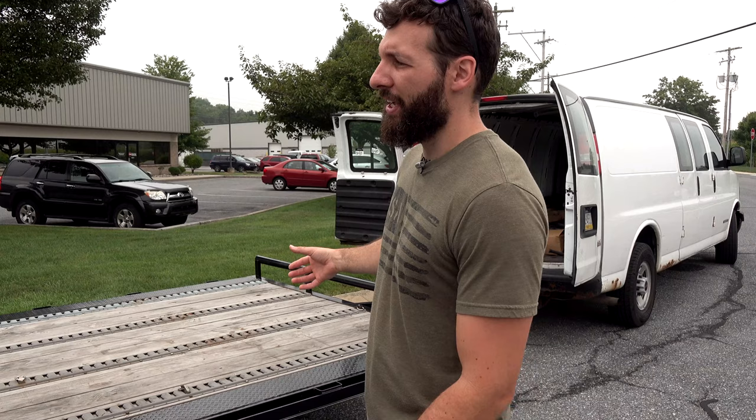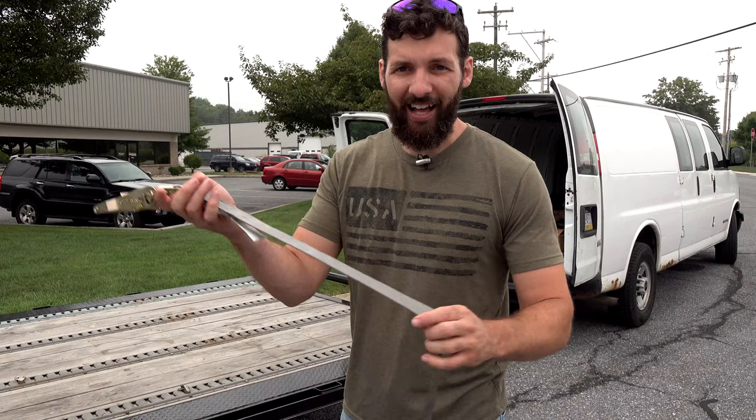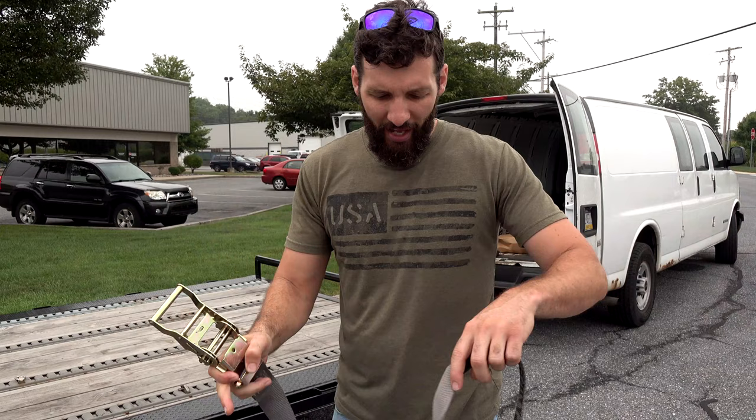Now these are for my own bikes. If you're packing a lot of bikes in an enclosed trailer and two straps doesn't seem like enough and they're kind of close to other bikes, use four straps — two in the front, two in the back. The reason I'm so confident using two straps is because I use really heavy-duty straps. A lot of guys are using straps that have a breaking point of about 1,000 pounds. This has a breaking point of 10,000 pounds — ten times stronger. You can really crank these things down. Even if the strap is a little frayed or rough looking, it's still going to hold the bike. It's made for tractor trailers and stuff like that, and it is an endless loop design — I'll show more about that once we do it.